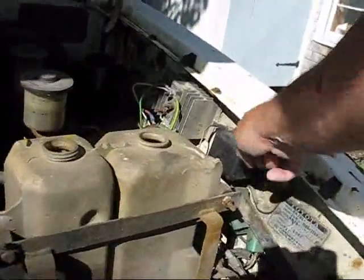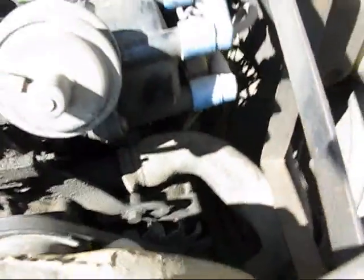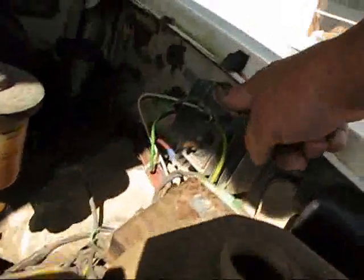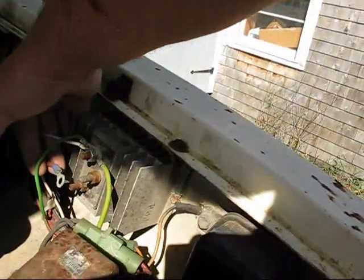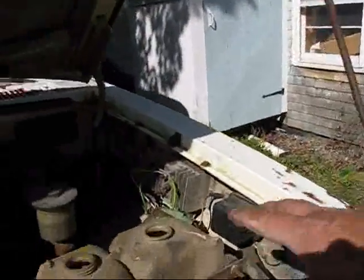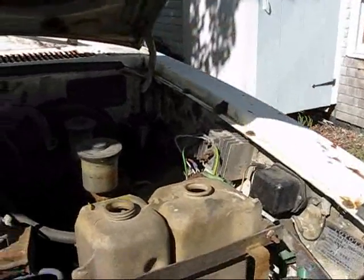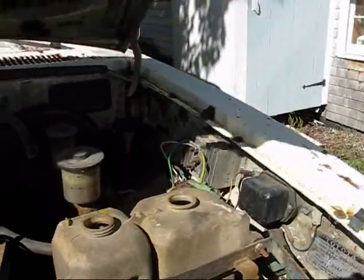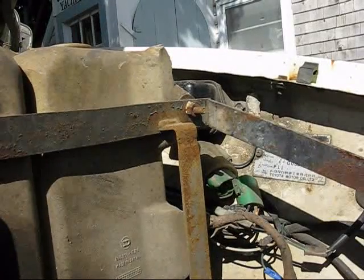Is this a voltage regulator? The reason I ask is because it looks like a voltage regulator, although this truck has an alternator. It's got a kind of unusual setup. It's got an alternator down there with a hot wire that runs up to this thing, which looks a lot like a 12-volt inverter. It's got this wire no longer connected in here, and it also looks like there's a place here for another battery. I'm thinking they had this set up so that the alternator would charge a system that would work the electrical stuff back in the back of the truck.